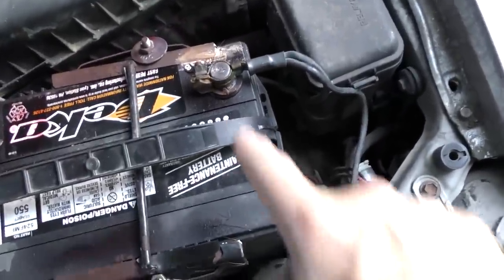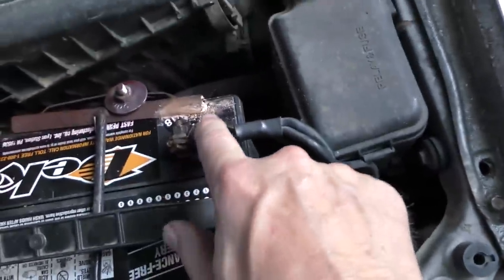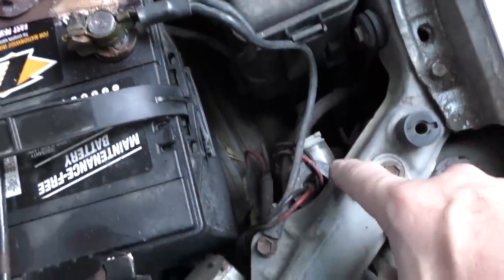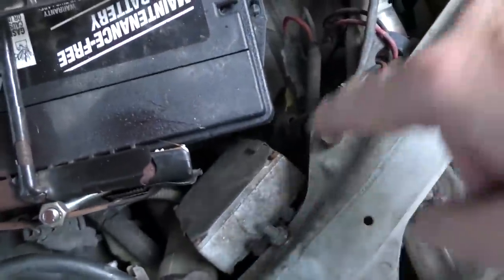Perhaps one of the most forgotten things when starting your car: the battery has a negative and a positive side. The positive feeds all the positive wires, but the negative grounds the entire car. If you don't have good ground circuits, it's not going to work. Make sure the ground end is clean, and follow the ground wire to where it connects to the chassis — make sure that connection is clean and not corroded. These ground wires are often hidden under things where you can't even see them. The engine-to-chassis ground has a lot of vibration and sometimes gets loose. I've had so many customers come to me with starting problems, and all it was was a corroded or loose contact on the positive or negative battery terminal.